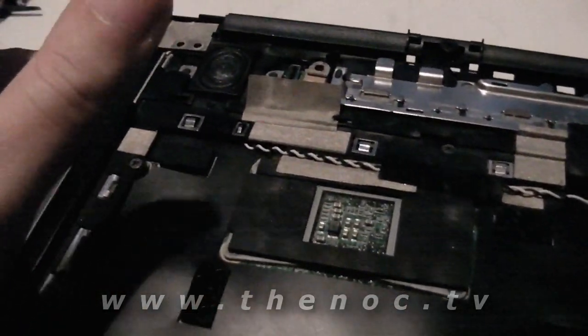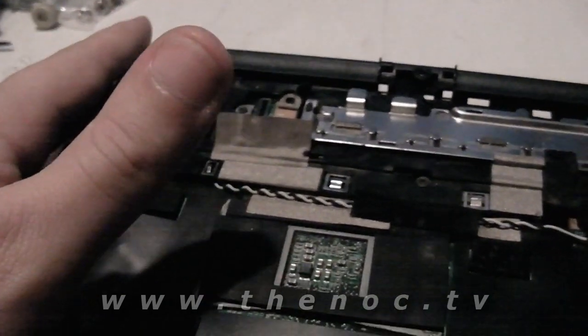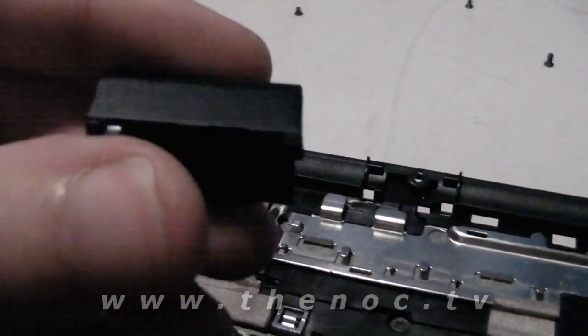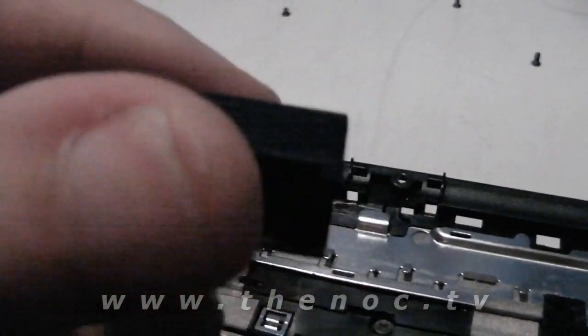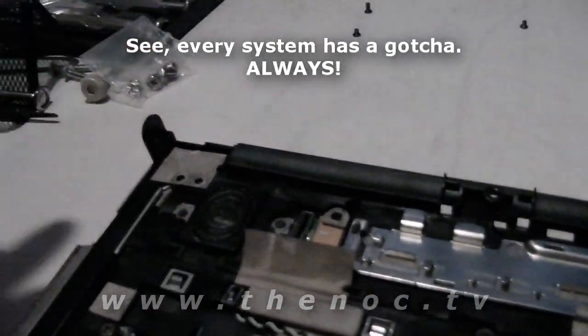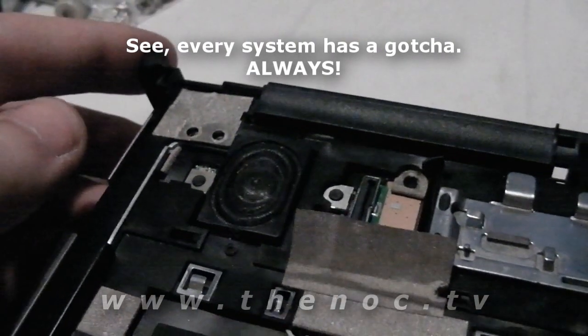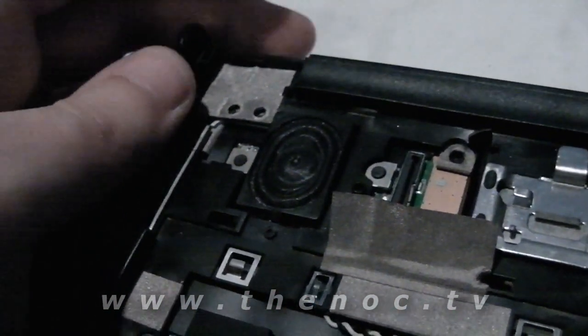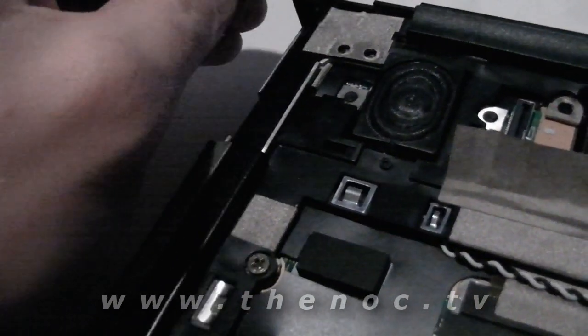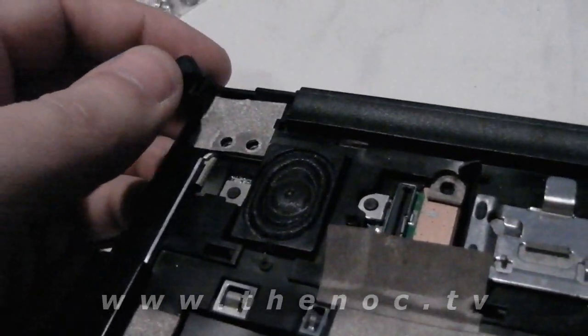Like I said, it came off that specific way, but one thing I should probably note out to you is you want to go through and probably take these little things off first. That's right, they actually have two more of these stupid things, these little hinge covers, on, of course, the left and the right. I didn't notice those, so that's part of the screen. But, yeah, go through and take those off first, because otherwise you could accidentally break the tabs on those, or, you know, possibly crack some of the plastic on the back or something like that. I was able to go through and just take it off straight up without having much of an issue on that, but for someone who might be doing it the first time, double check those.